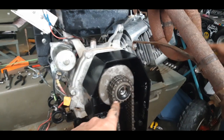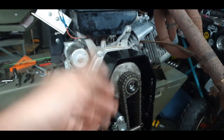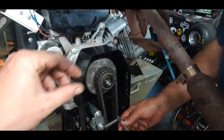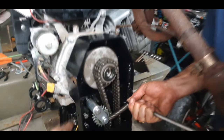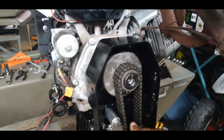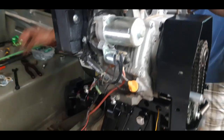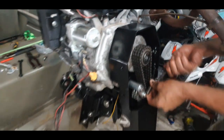Nice and tight. You have to put the clutch on the chain in the housing all at one time and then slide the engine through because you won't be able to get that chain over top of that clutch. And we had to use probably a quarter inch spacer on the back half of the motor there. After you get all that done, you can reach these bolts, which is why they are Allen wrenches. They are right behind the clutch, but you can get to them. So then you can put your four bolts in here and your four Allen heads in behind the clutch.